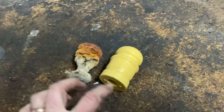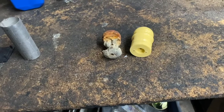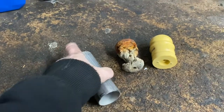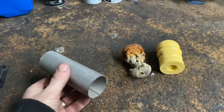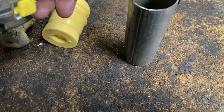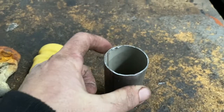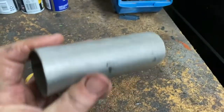There are a couple ways you can do it. I found out I did it with about a four and a half inch piece of regular muffler pipe. The size does matter because you need to sneak it into the spring area. This one is basically one and three quarter - one and three quarter outside diameter. You can use a little bit thinner but don't use thicker. I'll explain that when you have to slip it into the spring.